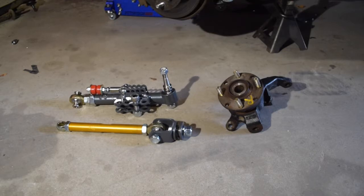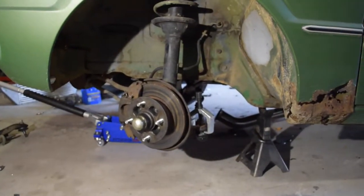We're going to do a little spindle swap. We got some T3 lower control arms — pretty excited. The reason we're doing a spindle swap is because I have some wheels I've had forever. They are 4x100, which is kind of weird for a rear-wheel drive setup — I think Miatas might have that. So I got some Mirage spindles, around 1990, and then we can use DSM front brakes and coilovers. That'll be in a later video, but for now we're going to get all this setup put in and whip the old stuff out.